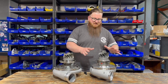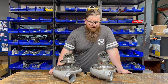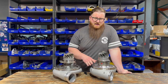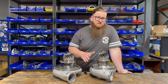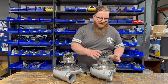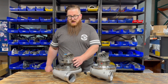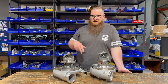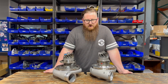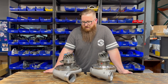If you have to have the best of the best, the GTX is going to be great — it's going to spool up really quick. Realistically, you can get away with going with a slightly larger turbo on the GTX because of the ball bearing design. It's going to be a little more forgiving from the standpoint of spool-up because it takes less exhaust energy to spin this wheel than it does to spin a journal bearing. We're not going to argue with science here — the ball bearing turbo certainly spins up faster with less energy than the journal bearing turbo.